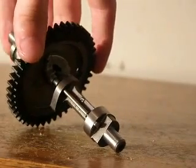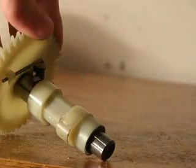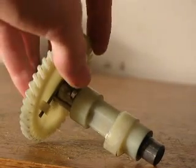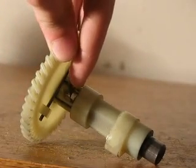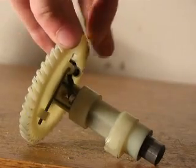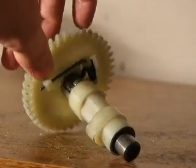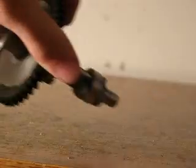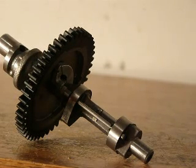That's really all these systems are. They look different — this is one on a plastic camshaft. It's from a smaller engine and it's a simpler design, but it does the same thing. This is the exhaust lobe, and it brushes up against that little tab there, and it opens the valve just at the initial start. You usually find these in Briggs and Stratton more often than not. I think it's because the engines are becoming more and more advanced, but that's really all they are. It's a simple little mechanism located on the camshaft, and that's what allows you to get an easier start.